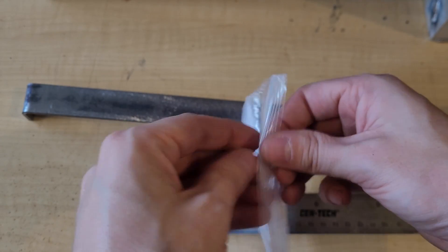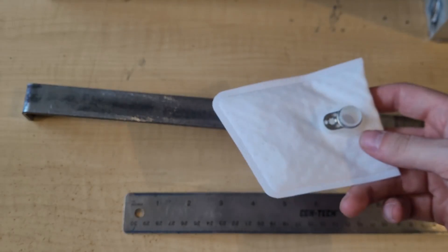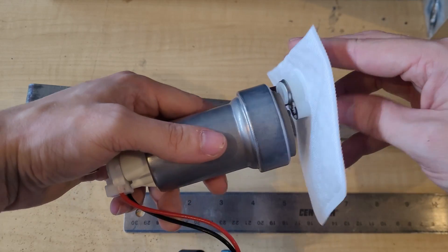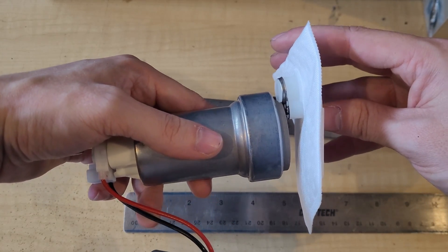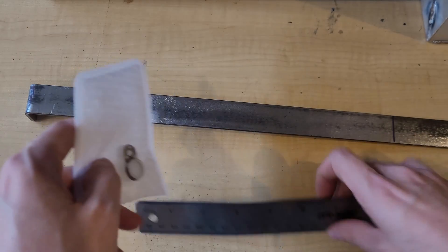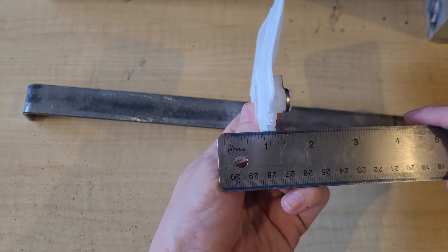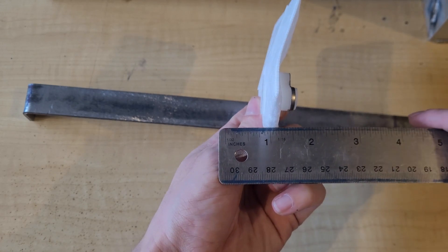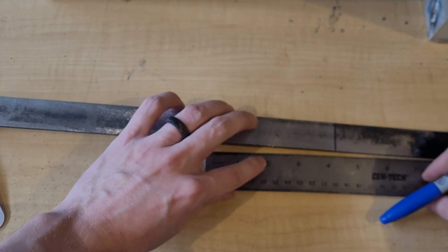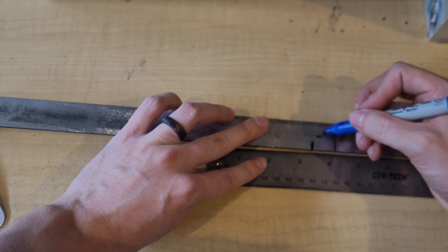Now we go on to making the fuel pump hanger. I started off with eighth-inch steel strapping — on the left side you can see a nice 90-degree angle that I'm going to butt the fuel pump up against. I opted for an in-tank fuel pump for convenience and single-pump availability to get 500-plus liters per hour. This is a Walbro 525, readily available for about a hundred bucks, and it does exactly what you need. The fuel sock is about three-quarters of an inch tall, so I back-calculate from the absolute maximum by setting the strap into the tank, marking it, then backing off for the filter.